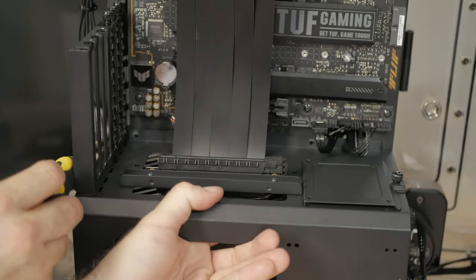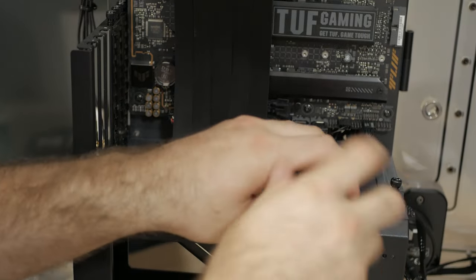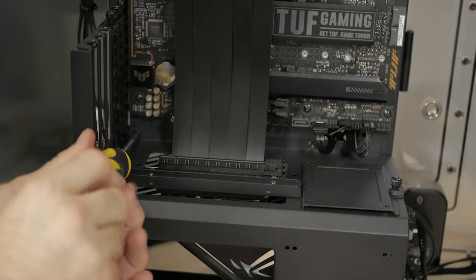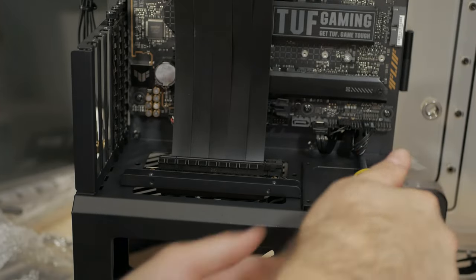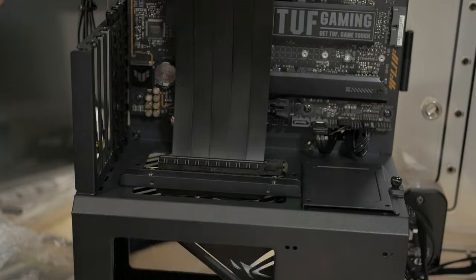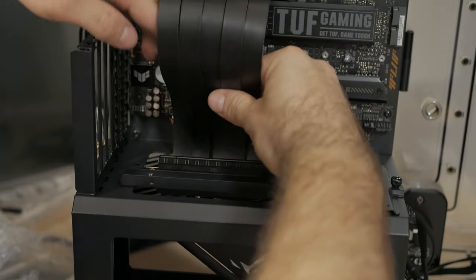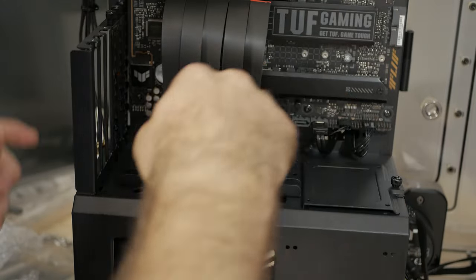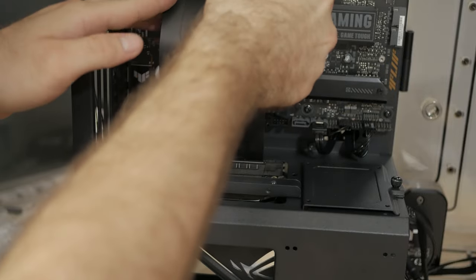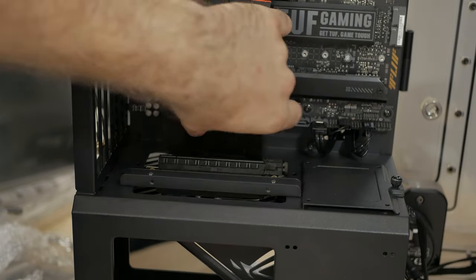Every other one was either not a PCIe 4 version. Some of them specifically omit that they're not PCIe 4, and deep down in the details, you can see it's PCIe 3. Now, I don't know the exact difference apart from the fact that there's more shielding on the PCIe 4 version, so maybe there's no actual performance difference, but I don't like the fact that they hide those details in there. So the 300mm PCIe 4.0 extender here was the only one that was 4.0. The cables were thick and I bent it enough and it still works. I don't know how long it will survive, but I've had to replace one of these twice already on my old build, and that didn't even have the big bend. It says high flexibility, but the flexibility for this build had to happen right at the joint where the graphics card sits.